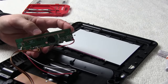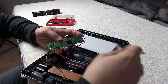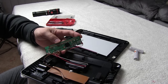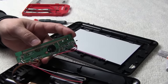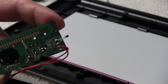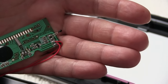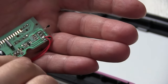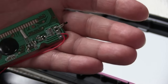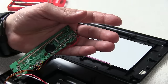We are going to be in luck - I'm quite excited because my guess is we can fix this. The first thing we have is the actual sensor. I believe this is what's measuring the temperature - it's a little thermistor. We've got a couple of diodes, capacitors, resistors supporting this. We've got the main brains of the clock here, along with the crystal to set the hertz, and a couple more resistors.